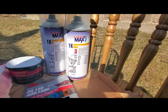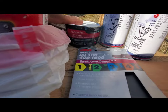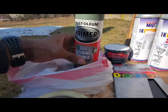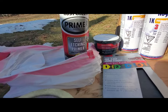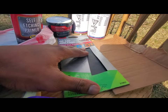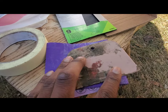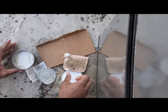So what we have here for the rest of this project: we got our paint — we gave them the paint code and it better be the right paint. We got our Bondo filler for filling those uneven surfaces. We got our primer — I'm using the rest of the owner's primer, the self-etching one, because it's a little thicker and it fills in areas pretty well. We got our sanding paper, cardboard to mix the Bondo filler and hardener together, our spreader, and our tape.